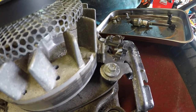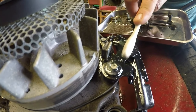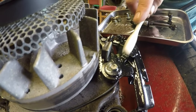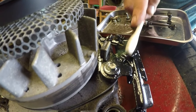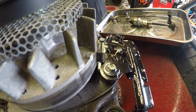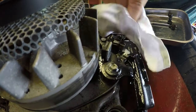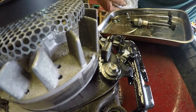All I'm doing is squirting some WD-40 and having a clean — that's literally all we're going to be doing. The reason why this is happening is because on these engines, they don't come with a cover on the back. It's one of the shortcomings of the Briggs. If they had the little tiny black cover on here, you wouldn't have that problem with grass getting in there. Good sort of clean out — and that's now working exactly how it should.